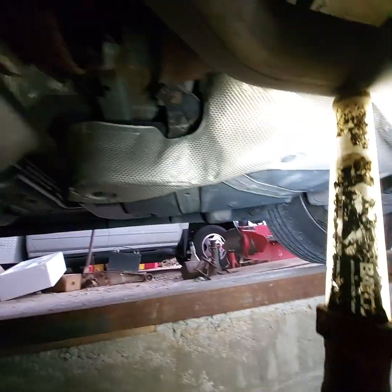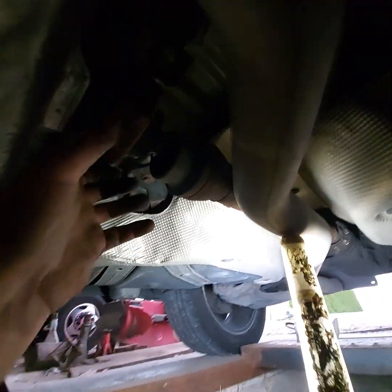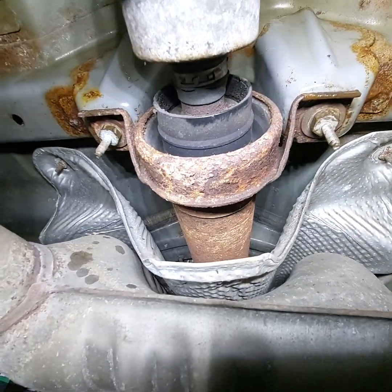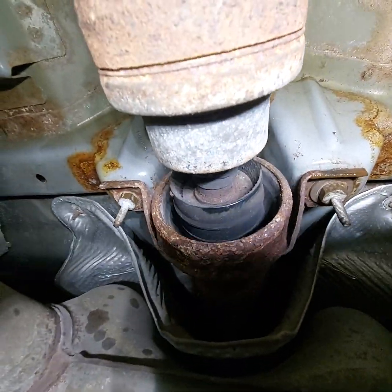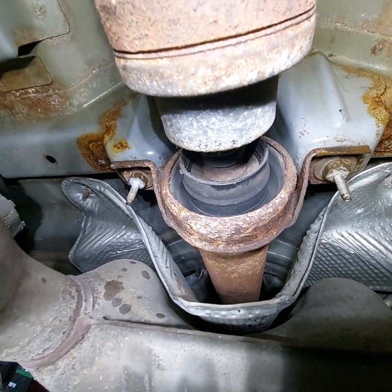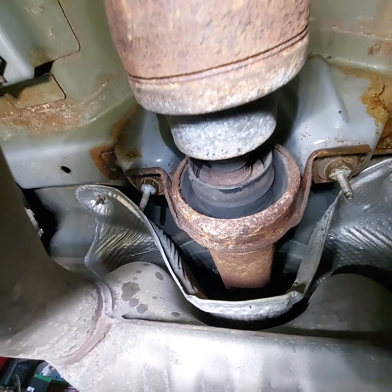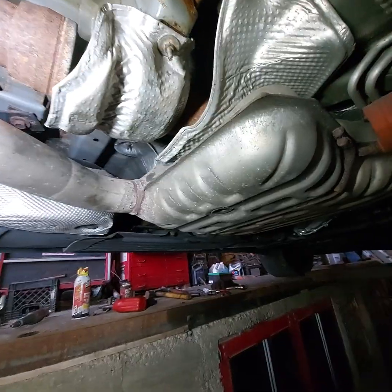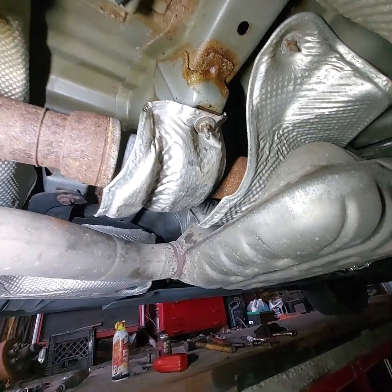And now we'll put the carrier bearing in. I think I showed you I got the front end, but I got to get 2 new bolts because they ruined 2 of them, and one of them is a Torx bit. It's not supposed to be. So get these bolts in and get that heat shield on. Now I lubricated those threads, the nut, which is welded to the body there, and the bolt, so I wouldn't have any problem with them going in, breaking off. This thing probably won't be coming back apart again, but if it does, hopefully it'll come apart and not break. So we'll get the heat shield on. Okay, then the heat shield's on.